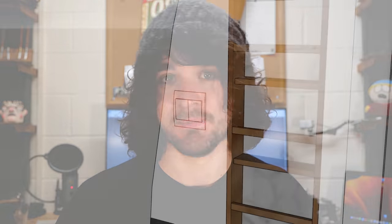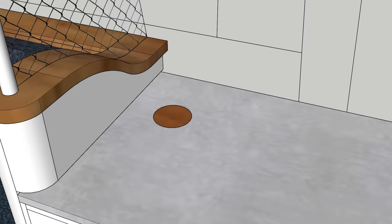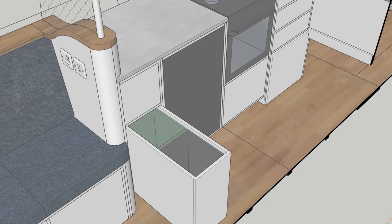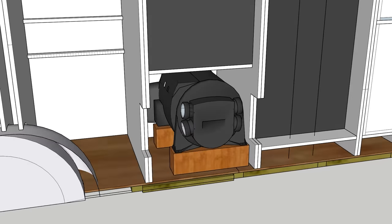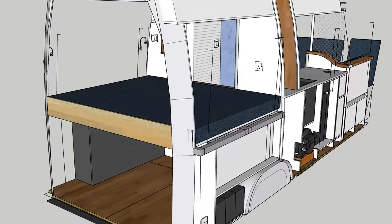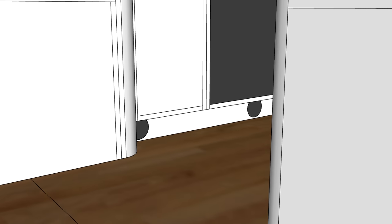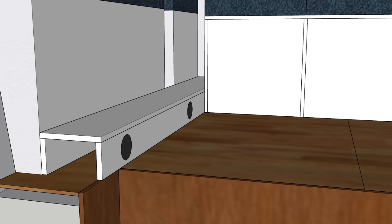The bottom row of LEDs is primarily for ambience, but the top one is to light up the area so the roof LEDs aren't casting shadows while I'm trying to chop something. There are also two extra drawers on the left — the top one includes a small compost bin for food scraps with a removable plug on top, and the bottom one will have a general waste and recycling bin on a sliding drawer mechanism. I wanted everything on the lower half as drawers because cupboards below waist height are just difficult to organize. Underneath the oven is where the heater and water boiler will go — I'm using the Truma 4E, which is very popular in the van conversion world. It has four outlets venting hot air to various points: the bed area, the wet room for drying clothes, and two towards the front of the van, possibly with a Y-junction to warm up the driver's cab.